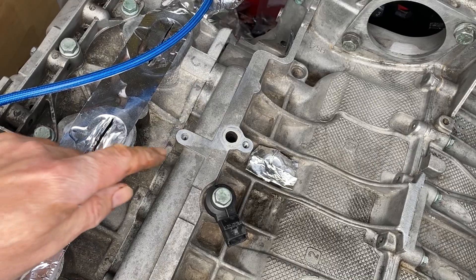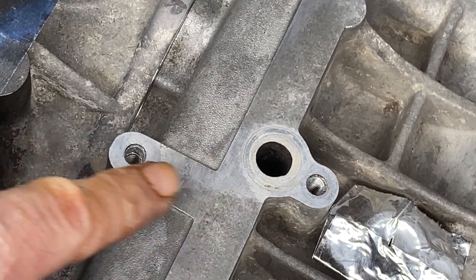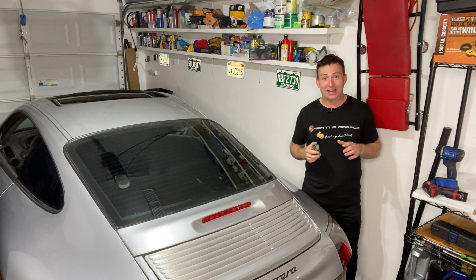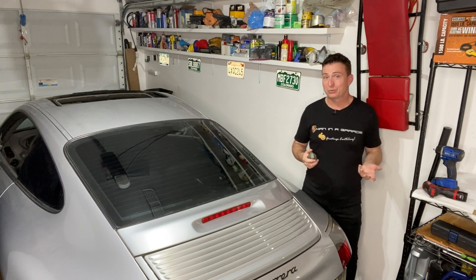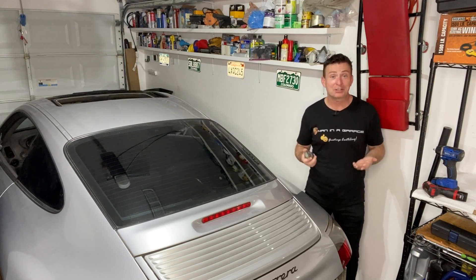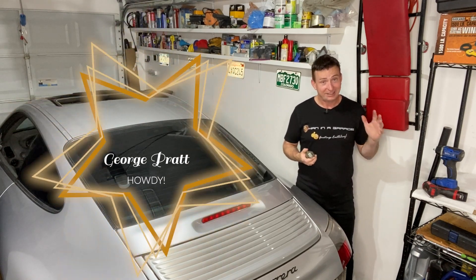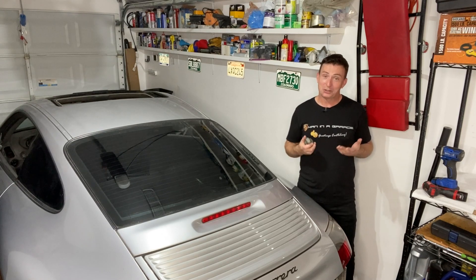After removing the gasket, I had a look at that particular bolt hole. Notice the one on the right hand side has threads, and the one on the left hand side does not — oh no. That's obviously not good. I did look into it on Google, and there is a thing called a helicoil kit that you can use to put threads where there are none, so I'm going to be looking into that. If any of you know anything about helicoil kits and which one I should use, please let me know in the comments. And perhaps the newest member of the garage, George Pratt, knows the answer — thank you very much for joining the garage and helping support getting this beautiful car back on the road. Unfortunately, I have to figure out how to fix that thread, and that's all we have time for this week.